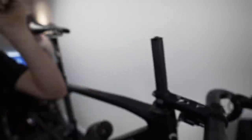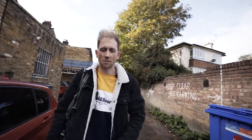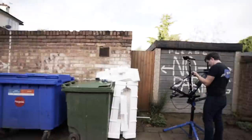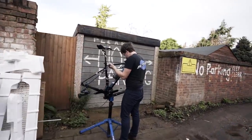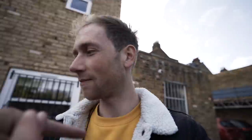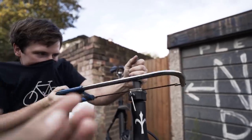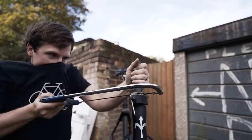Probably need to take off most of it. Marking the top of the stem — we'll just do a V on top of it so that you know that's definitely the line that you're cutting. What are you doing here? What are you doing in this back alley? Chopping a steerer. You've got to be well ventilated to chop a steerer. Lawrence has got a new bike — he's not letting me film it. They've got to go to your channel to see it. Always wear a mask — always — because the carbon dust is horrible. You don't want to be inhaling that.